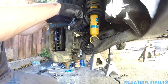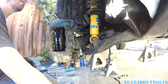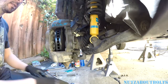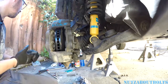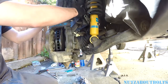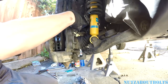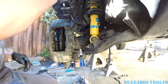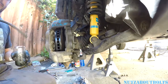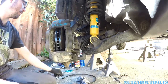The next thing you've got to do here is transfer the brake line. You could pinch off the rubber line to stop the fluid from gushing out, but if you're slick about it you shouldn't dump too much fluid. I'm going to unthread that now. I already got my bleeder ready to go, because it's kind of just going to gravity bleed — leaving the bleeder open and just letting all the air run out as the fluid travels down into the caliper.